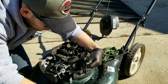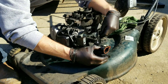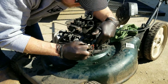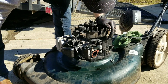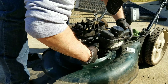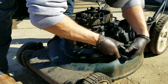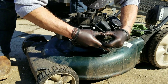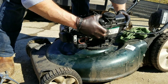Got to put the cable back in there - simple enough. That goes over top, over top - yeah, there you go. Want to make sure I got a good seal there - looks good. We got to put the fuel line back on with the gas tank. This is not the job to do on the ground fellas - definitely put it up higher when I do the rest of these. All right, we just put that clamp back on the hose there and go ahead and reseat the fuel tank.